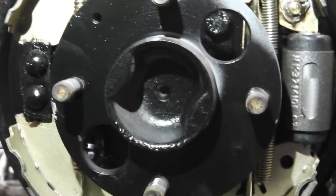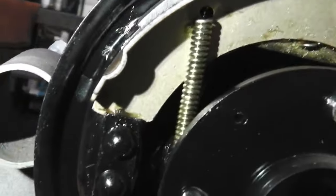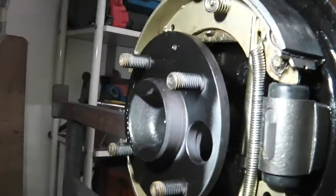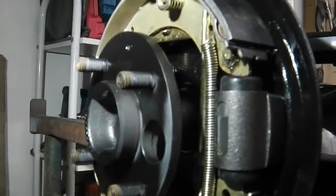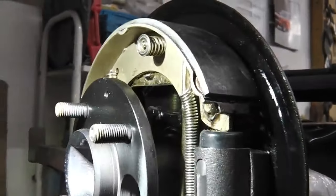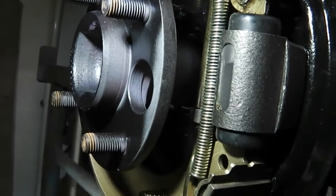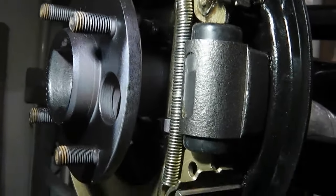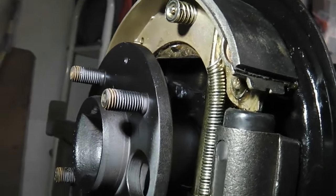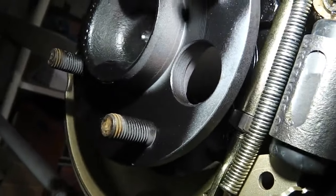So I'll try and get some exciting footage down, but it's quite useful for you to have this video reference of the brakes. Now, I know I'd find this interesting if I was watching the video, so the chances are someone else out there may think the same way as I do, and that is, let's operate the handbrake and watch the ratchet go. Now, it works on its return journey, so when you pull the handbrake, it actually won't adjust it until you let go of the handbrake, and that's when it pushes on the pins. That's what it seems to be to me.